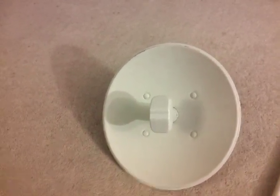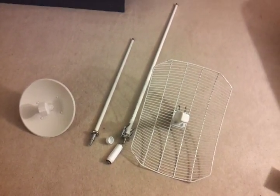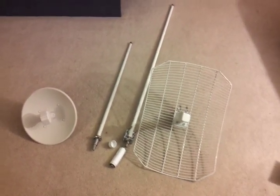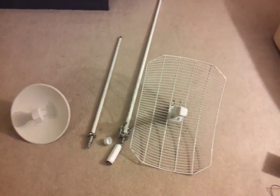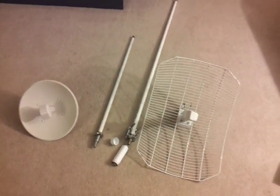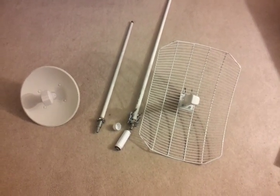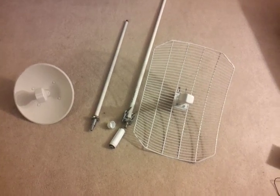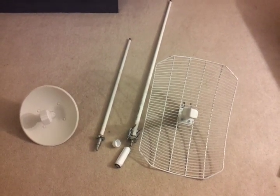The dual polarity gives a little more throughput and better reliability. That's why I like the Ubiquiti gear — they're all pretty much standard, very simple to use, with a web GUI to program everything. Compared to standard mesh setups people are deploying now, you don't have to worry about messing with firmware, changing a crystal to adjust frequencies, finding an outdoor box, or finding power to run up to it. These have power over ethernet, which sends 24 volts up to the antenna via the included power adapter — right up the spare four wires inside the CAT5 cable. No extra cables, no adapters, no connectors to seal up. You just pop these on, throw them up on a tower or hilltop, point them, and the LEDs give you a basic signal reading. You can get a better reading from the web GUI. Very simple compared to the WRT54Gs — stick it up and it gets the job done.